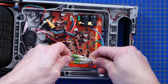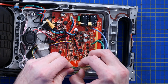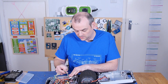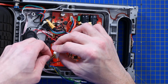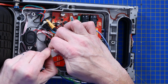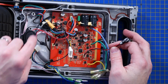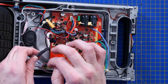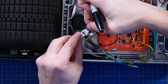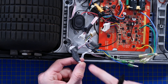That's the motor connector — three poles, colour coordinated. These look like the sensors because this will be an electronically commutated motor, so those will be your three delta-connected coils. And these five pins will be hall effect sensors, which give it the timing of when to energise and de-energise each coil. That black and red lead appears to go through the casting, which makes me think that must be the pressure switch. I'm impressed that even these little connectors have got heat shrink over them. I'll do a mark across both connectors so they'll match up.